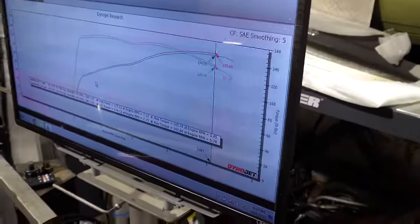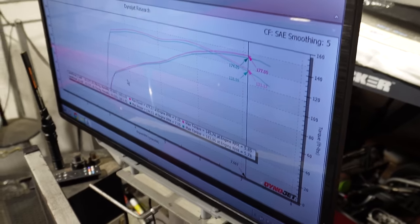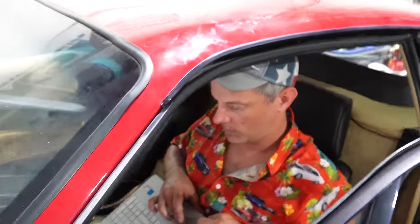Well, as we keep making pulls, we're running into that issue of a high RPM sync loss. What that basically means is as the engine was turning faster and faster, the engine wasn't getting a perfect crank and cam signal. It didn't know 100% where it was, so whenever that happens, it basically will stop fuel and ignition so you don't break things. We were trying to close the air gap and open the air gap, and then Kevin had the idea that the valleys, the teeth, weren't very big on that wheel. Yeah, the tooth is not tall at all, so the sensor isn't seeing the signal really go away. That's my theory anyways.